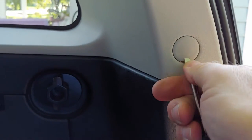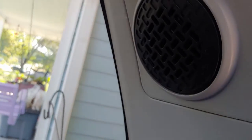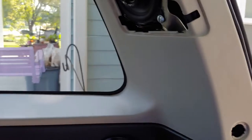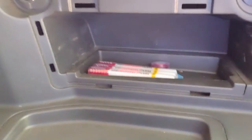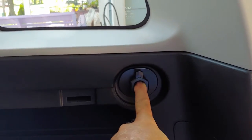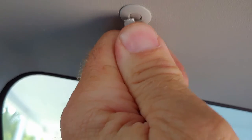To get back there where the seatbelt is, you've got to take this gray panel out as well as the black one below. You don't have to take it all the way out, but you just have to lean it back. Back here on the corner I'm going to get this guy out. Both of these bolts need to come out — it's a 10mm socket. This little guy above the window needs to come out too. You just pop it in just a little bit and with your fingernails you can just pull it right out.